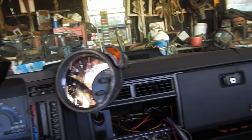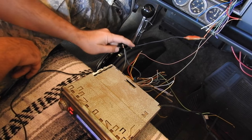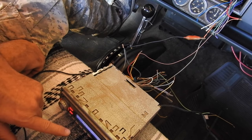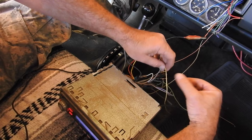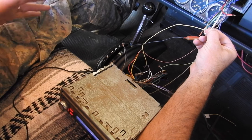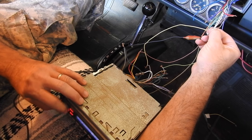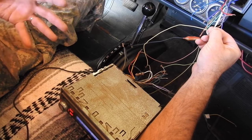Who knows if there are really speakers in the dash — I've got some speakers somewhere, they're probably hanging out with that antenna. I've got to find those, get them installed, get the antenna installed, get the stereo installed, and then we're done. I've got the key on with some spare wires from when I did the truck bed trailer. Hot wire to the red, ground to the ground — and it lights up. If I take these two wires and go to the grays and the whites, these speakers actually work. It's kind of a shame to use those old speakers with the new system, but for now, that's what we're going to do.